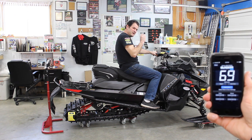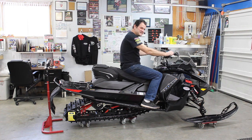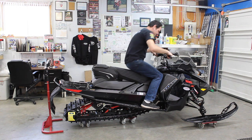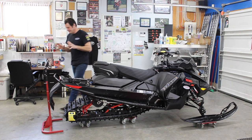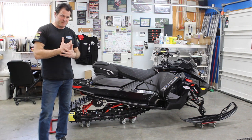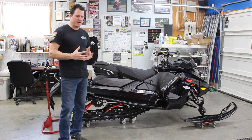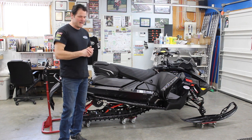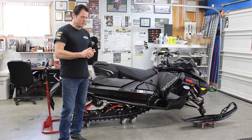If you're seeing a big discrepancy in the numbers — this skid is not only brand new but meticulously lubricated — so we're seeing nice repeatable numbers. 68 to 70 millimeters is perfect, because we want to be just under three inches. I don't have my helmet, my gear, my boots, or any riding gear on, and there's no snow in the tunnel. So if you revisit this halfway through your riding day, you might need to move up another preload position.